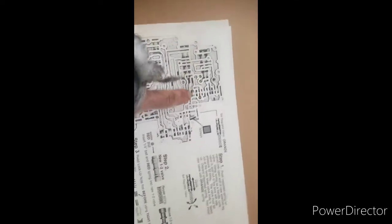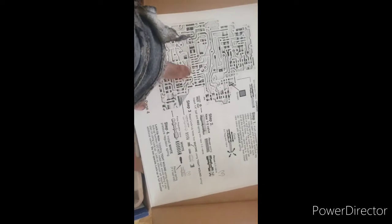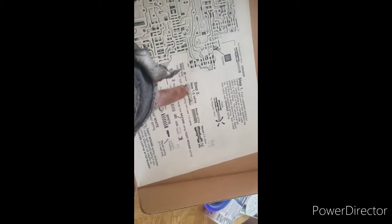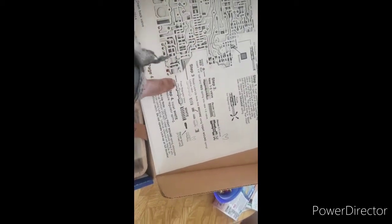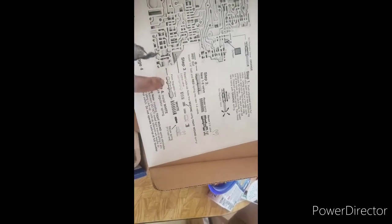So here's a better diagram of your valve body. You've got your shift valves in here, as you can see, and all of these roads fill up with fluid, and you've got your main shift valve here. This shift valve will shift. You can see here, this actually explains what it is. This one's your regulator valve, which has a screen in it. This one is your 1-2 shift valve, your pressure regulator valve, your lockup valve here, solenoid, I'm assuming that's a solenoid regulator valve, the drain back valve. So here we go. Here's more.